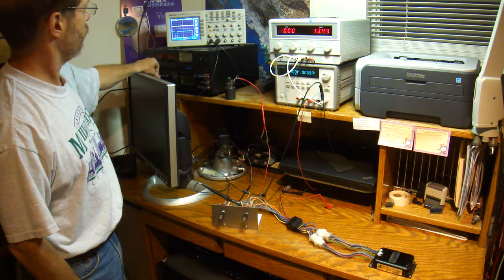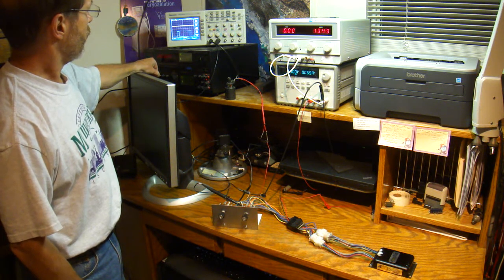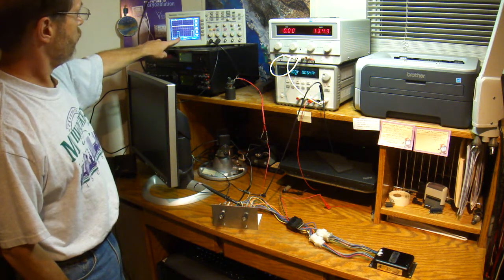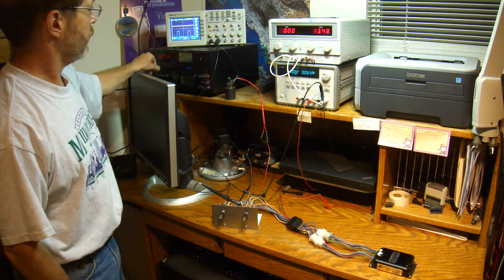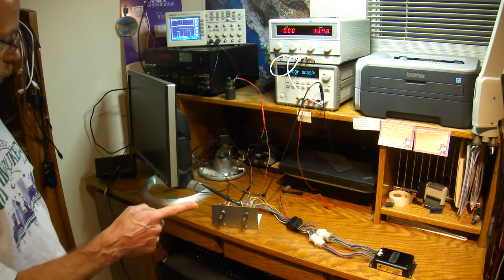At this low duty cycle, it's about what you might see at idle. If I change this knob, I can turn it into a very long duty cycle — this is what you might see at wide open throttle, probably about 80% duty cycle. So let's throttle it back a little and see if this VersaFueler works.